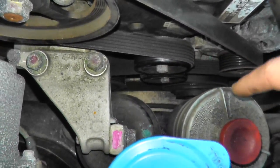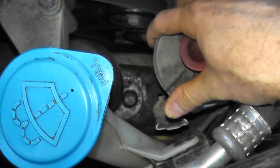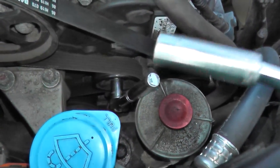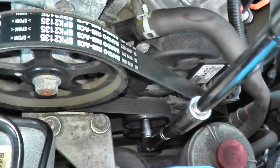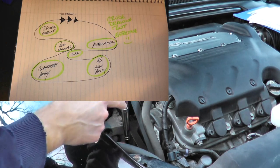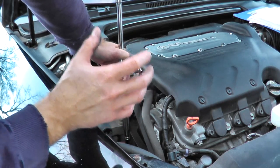The space is very tight. Where the power steering fluid reservoir is, there's actually just a holder — if you just pull it up, it simply moves out of the way, and now we have clear access to the bolt. Because this is incredibly tight, you can create a small extension: just a socket fit over the end of the ratchet with some extensions on the end, and it'll be a lot easier to drive off the belt. Before you remove the drive belt, make a little sketch of how it's installed — the routing over the alternator, the power steering pump, and so on — so you know exactly how to reinstall it.